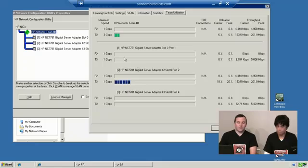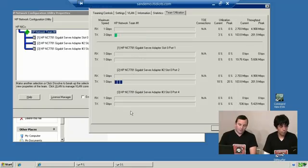And as you can see, typically only ever one of the cards is used for receiving, and we can copy that file around in a minute to show that. So if you are going to do teaming and you want to actually load balance across all 3, you need to use a protocol such as LACP, and you would need to do some configuration on your switches.